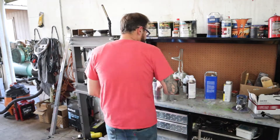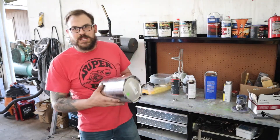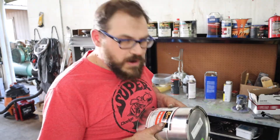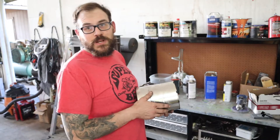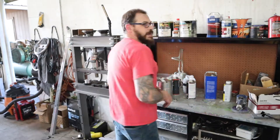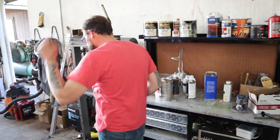I need a screwdriver - we're gonna get this can lid off and then we're gonna mix some paint. This paint's mix ratio - I'll make the print so small - four parts color with one part hardener. Make sure you read how many parts your paint is, because they are all different. It depends on what paint you buy and what you're doing with that paint.